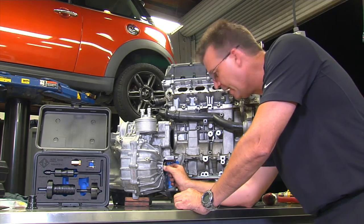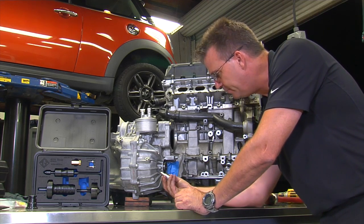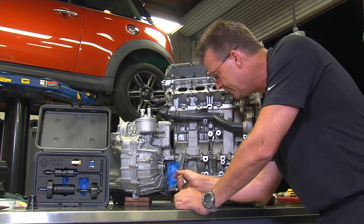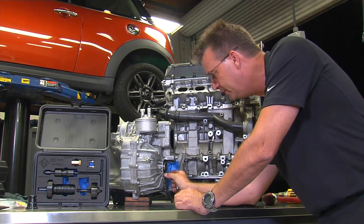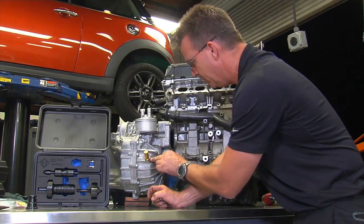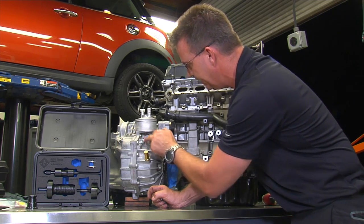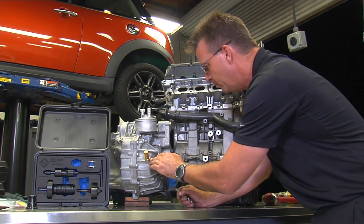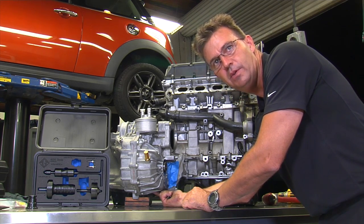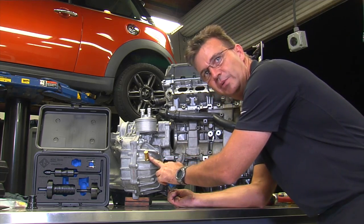Now that we have the axle seal replaced, it is time to fill the differential fluid. You start with taking a 10mm socket and removing the drain plug in the bottom. There is an insert coming up that allows the fluid to be set to the correct level. To fill the transmission, you use a special socket provided in the kit that fits onto the fill plug. Take care not to confuse the fill plug with other ports in the transmission. Now, with the fill plug removed, you continue to add fluid until it runs out of the bottom hole. Allow it to finish dripping and reinstall the drain plug on the bottom. Install and tighten the fill plug on the top.